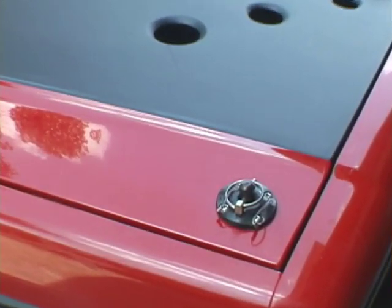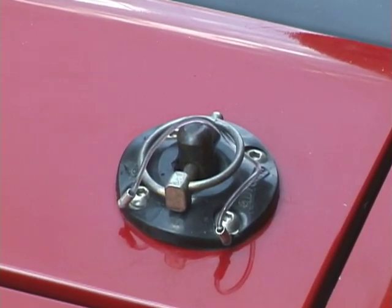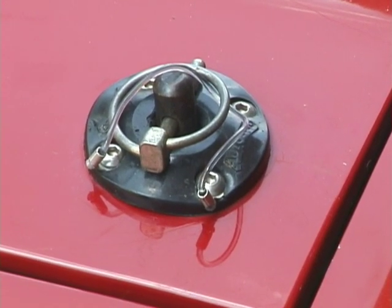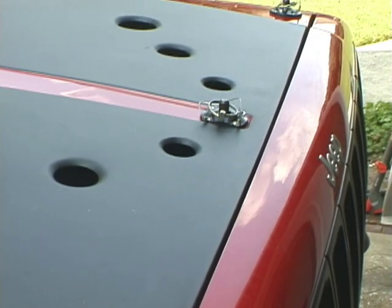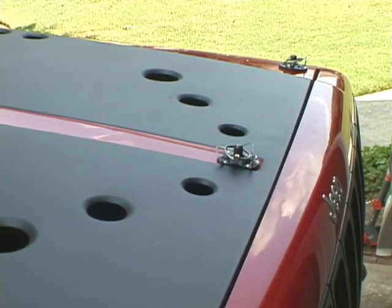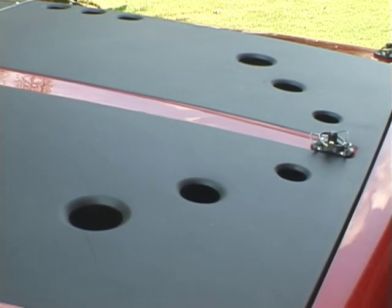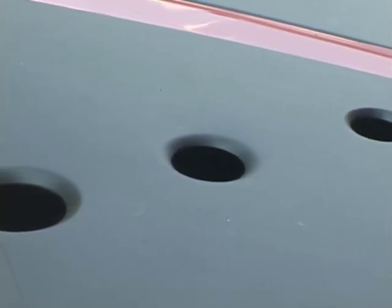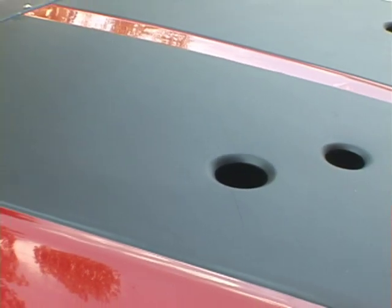Here's a great view of the Auto Fab hood pins — there are three across the front and two across the back. They're held down with some good fishing line because the original stuff breaks very easily. There's flat black paint across the middle of the hood so you can drive right into the sun with zero reflection, which works very well. There are three different size dimple dies across the front and one different size across the back.